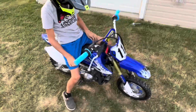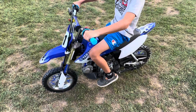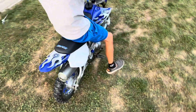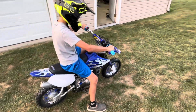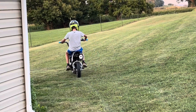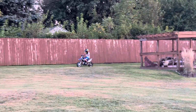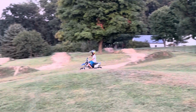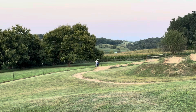All right, he's anxious to ride it. We're gonna run it through its first heat cycle, just very easy. Next one we'll get on it a little bit more, seat those rings, but it's running a lot better already. It's not smoking at the idle yet. I know our wrap's gonna be smoking here shortly as soon as this thing heats up, but go ahead, dude. Sounds a lot better already with that repacked pipe. All right, other than the exhaust wrap stinking and smoking, it's running fairly well. A little bit of popping at the low end. I blame it on that carburetor. It's an Amazon Kippa. It did not come with the stock carb. I maybe have to look for one.